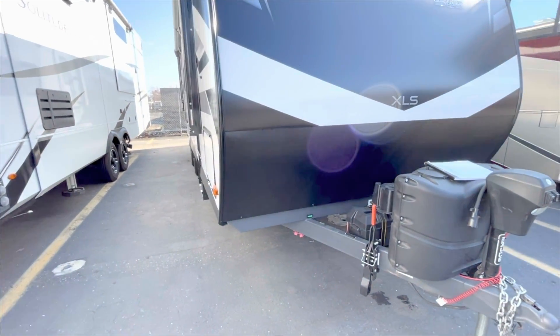The tail lights — you can see the sealants are all cracked and separated. You can see the actual holes and openings in them, so make sure you're checking that. You can see the dirt marks where water and dirt has run down hitting these areas. Sometimes just the smallest drip coming from a corner up there can cause a lot of headaches over time. There's a missing tire cover, so I'll recommend one of those. Another thing I see a lot is they'll use a foam pad seal behind the ladders, but there's no silicone around this. The cap seal basically acts like a water deflectant — we want to keep water from intruding back behind and causing damage to the screws and walls. Water deflection is a big one for me.